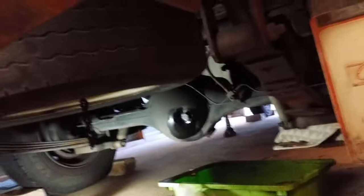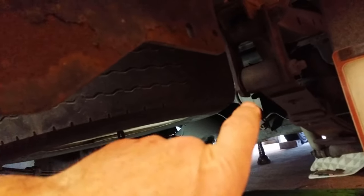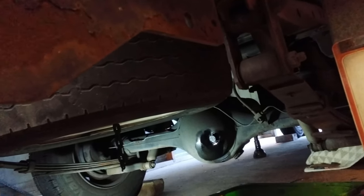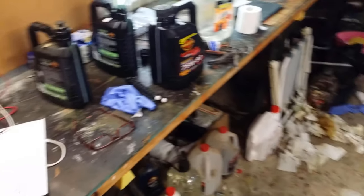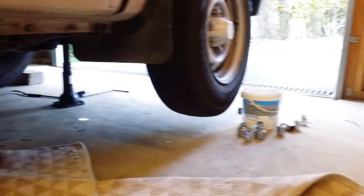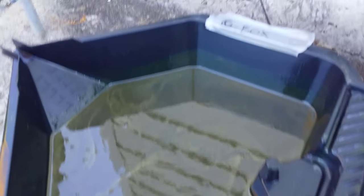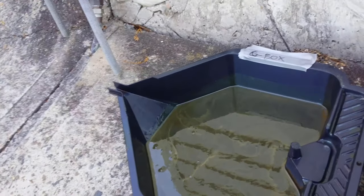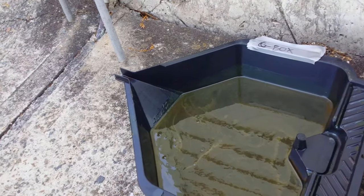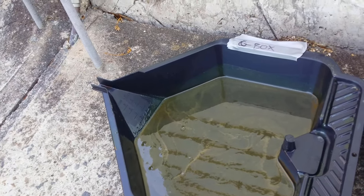That's it — just a matter of wiping it down. That took just over two litres, so 2.5 litres. Just packing up the mess now. The diff used 2.5 litres and the gearbox used four litres — I checked it twice and it's still reading 2.5 litres drained out. Maybe I could have levelled the truck to let it drain better.